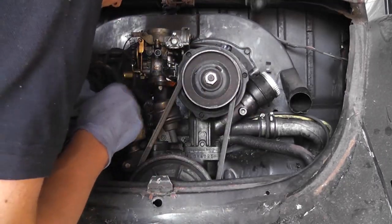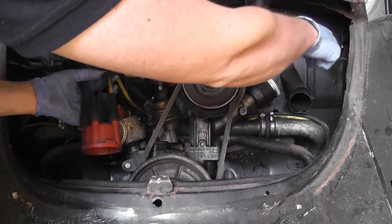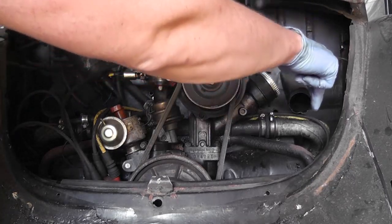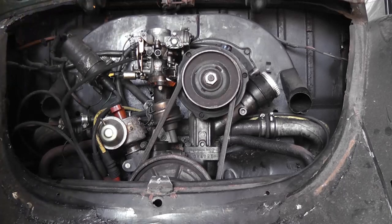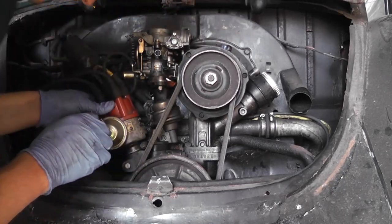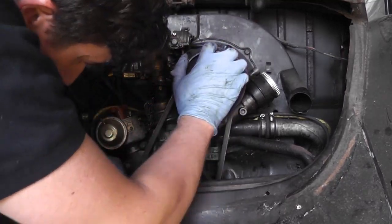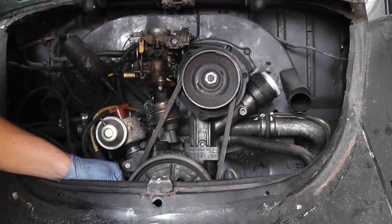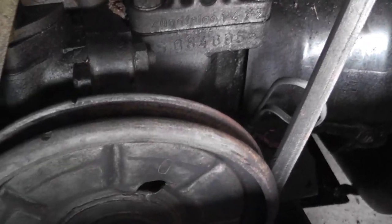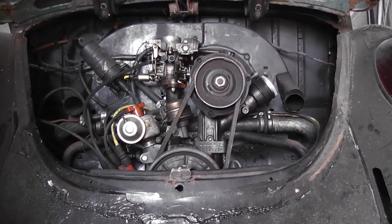My yellow lead is going to number one. You've got one right at the back, then two, and three is at the back over this side, and then four — remember it's a flat four engine folks. So that yellow lead is going to number one cylinder. I'm going to get it to top dead center at number one, so I'm going to rotate it and we're looking for a notch in the pulley — there it is. You can see our notch and that lines up with the split in the case. So that's our timing mark — I just want to leave it at the timing mark.